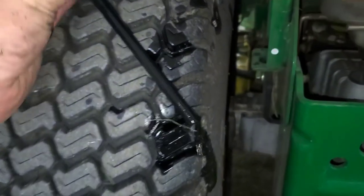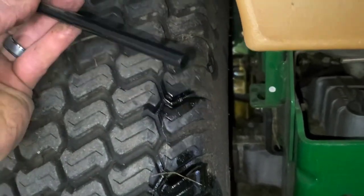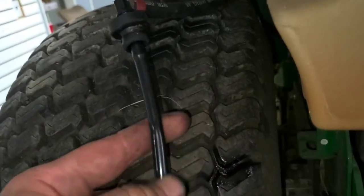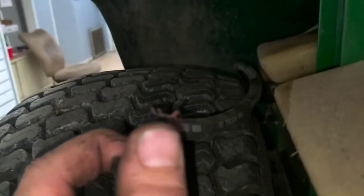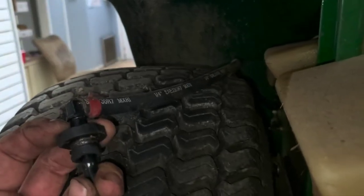Now you want to make sure in your tubes there's no cracks, no nicks, no bends, and you will look down through it, make sure there's nothing stuck in it. If there's a crack or anything in it, it won't pick up right. This here is obviously bad, the grommet is, so again, we'll replace that. We can just take that straight down and off. So that just comes straight off of there, and then you insert another one into the tank there.